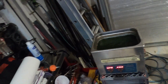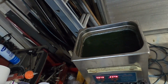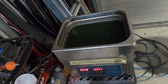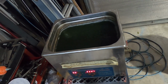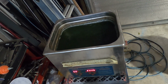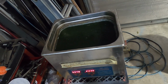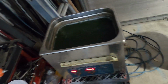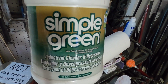Okay, this next video is going to be on carburetor cleaning, and we need to start out with one of the modern day conveniences known as an ultrasonic cleaner. It has a heater element for it, and it also has ultrasound generating cones underneath it. And the mix that we use is 50% water, 50% Simple Green. Works quite well.